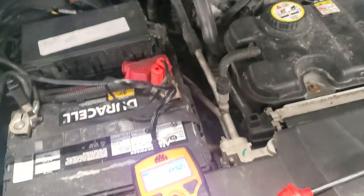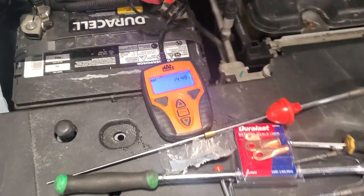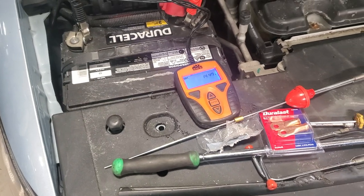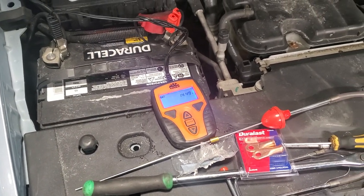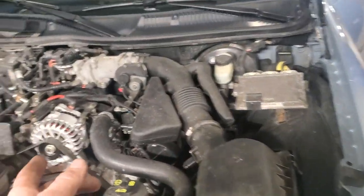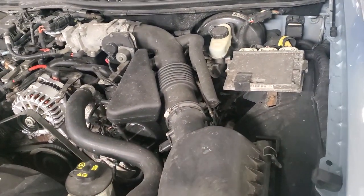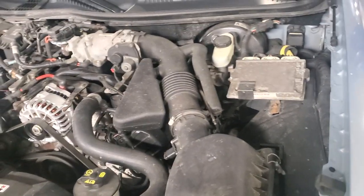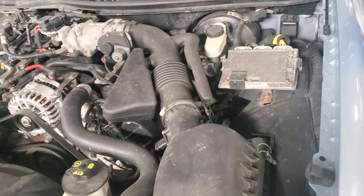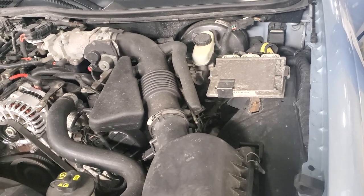It's sitting at 14.4 volts — it's come down a little. It was off at 14.9 to 15 volts at one point. Everything seems to be working fine now. I may have a bad PCM, because the PCM is what helps control the regulator — it's what turns it on and off. I want to get a PCM with a lifetime warranty, ordering out of New York for about $225. If it ever goes out, it gets replaced.